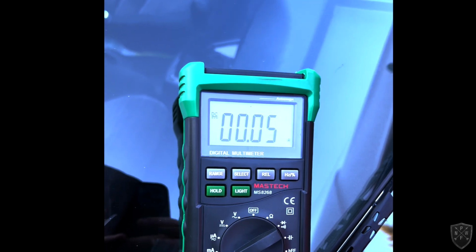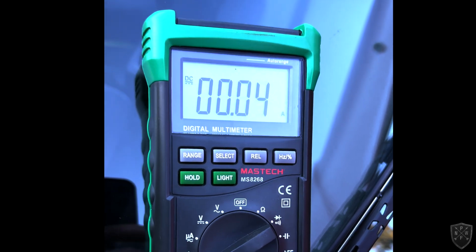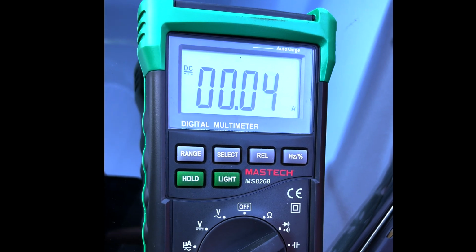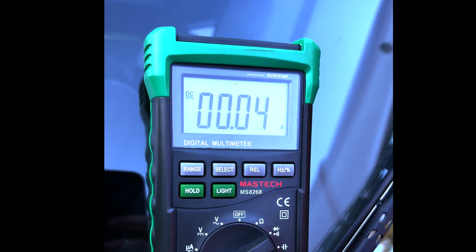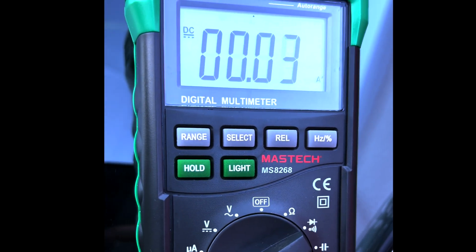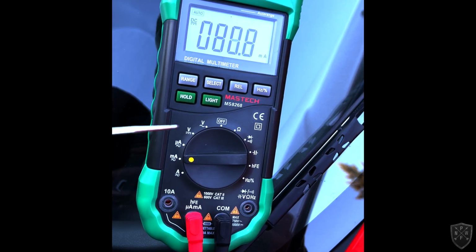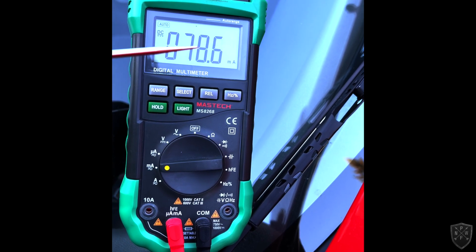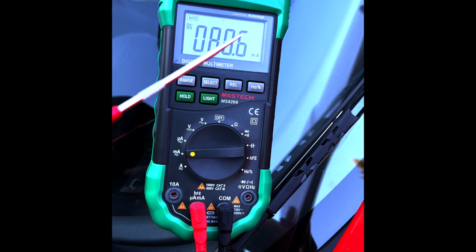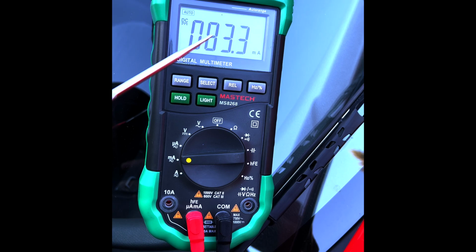Okay, here's what we're left with after completely unplugging both harnesses on the driver's door for the seatbelt system. Basically, I think I need a new seatbelt, and I'm told there's a lifetime warranty on these. I'll talk to my dealer and see what's up, but this is much more acceptable. So hope this helps, since I never saw a video of CRX people doing this. They just talk about it online. Oh, and after unplugging both harnesses, we're in milliamps now, and we're much closer to the 60 or 65 milliamps I think Eric the car guy said we're supposed to be at. We're close. I don't know what extra I can do to get there, but see how it's fluctuating. Now I do have an aftermarket alarm, so that could be part of it as well.